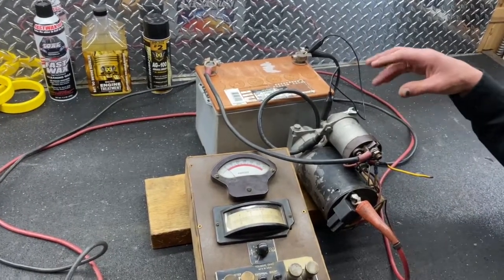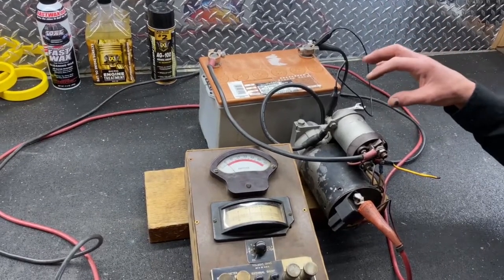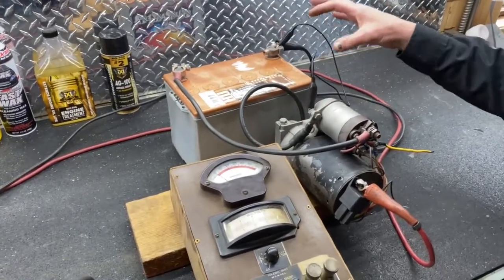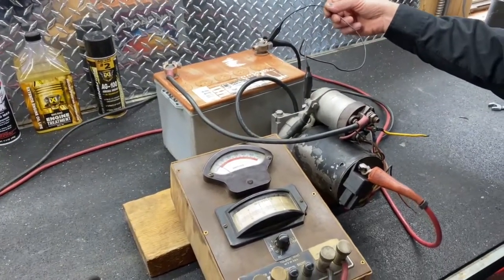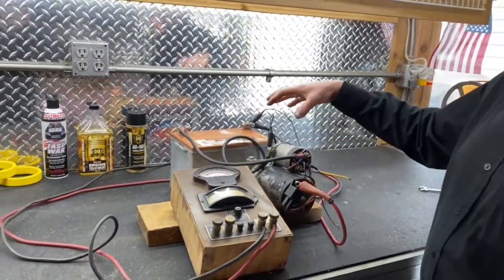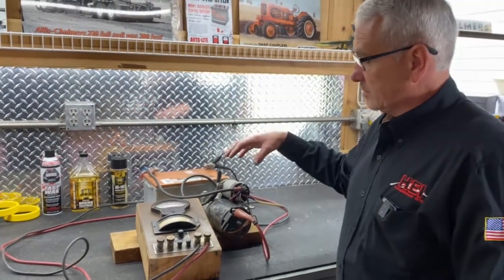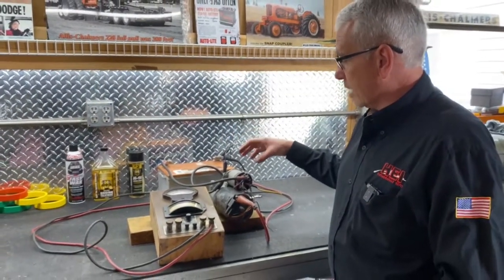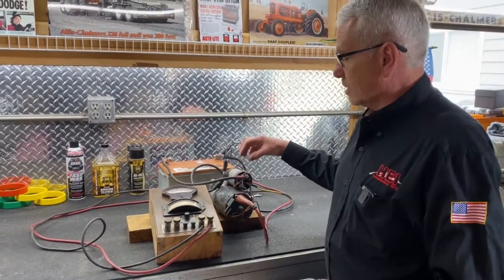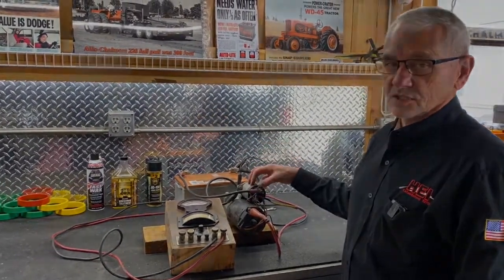When you find that kind of problem, you need to start tracing the wires in the vehicle to find out where the ground is bad. We're doing the ground side here, but it can also be on the positive side. The demonstration shows the ground has a huge problem — too small a wire simulating resistance. The vehicle needs to be checked because the starter is drawing its amps to operate and the ground can't carry it.